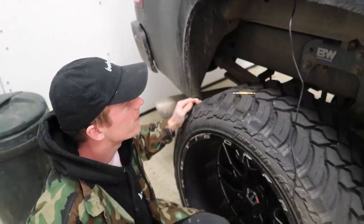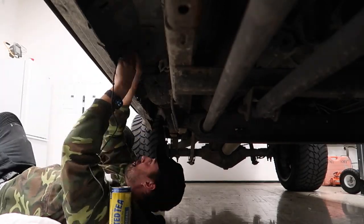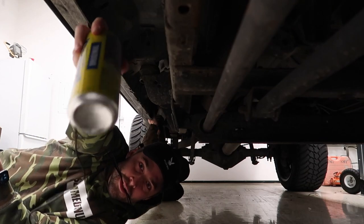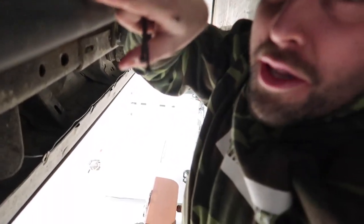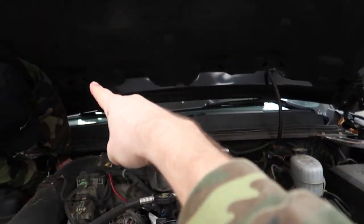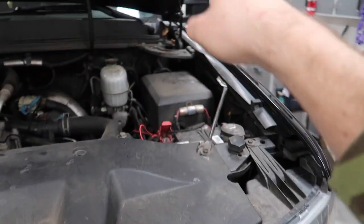That thing isn't going anywhere. Alright, now I'm just gonna route the wire under the truck to the front. From the back wheel well, we just ran it along the bottom of the body here, and then straight up into the engine bay. We'll go over to the battery — come across to the battery over here. That's the far back passenger side, so that's the hardest one. Once we run that one, then the front, then the back, then the front.